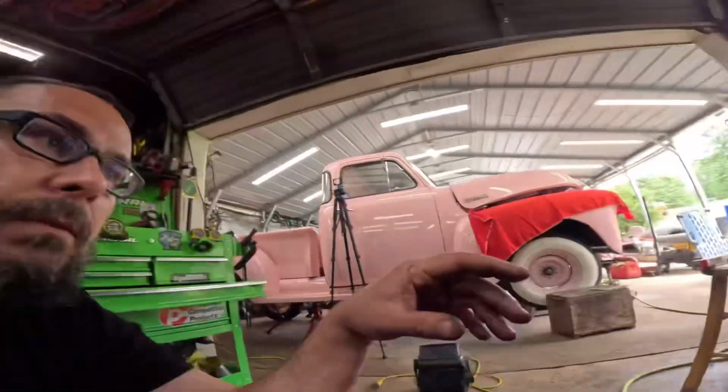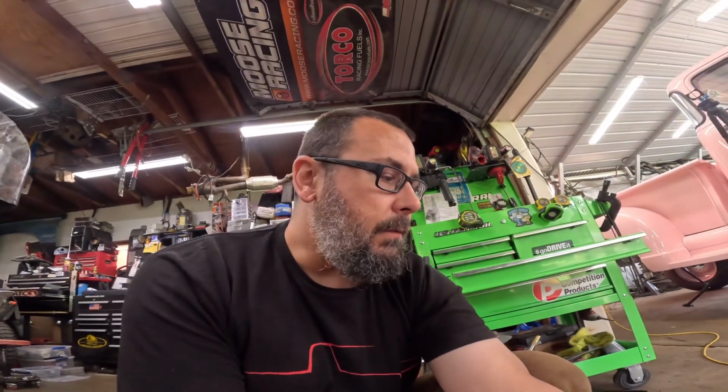And I take the valve covers off, and I'll crank the motor over with the ratchet while it's pushing that oil in. And typically 90% of everything, all the valve train, all the upstairs stuff is oiling by the time it's done. But you don't want to run this thing dry and push air back through there, because then you're kind of defeating the purpose. Periodically I'll close the valve and check the dipstick, and when we're at the full level, call it done. It leaves a little bit of oil in the tank. Typically we put more than 5 quarts in it just to be on the safe side, but you got to stay on that dipstick without having a sight glass.